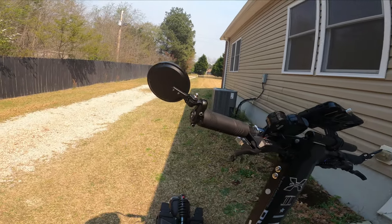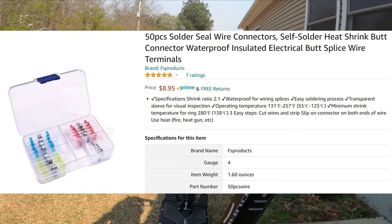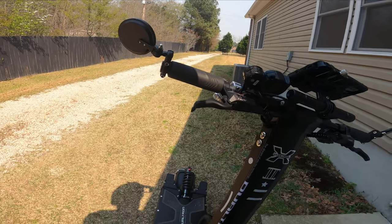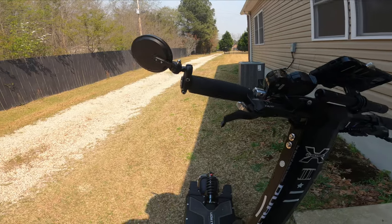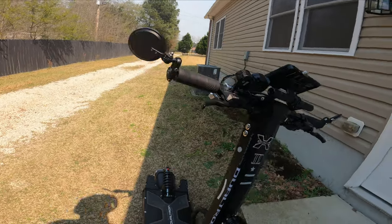And then I just also wanted to experiment with those shrink wrap soldering tubes there with the solder on the inside of them to see how they work. And they work pretty good. I just didn't like the amount of heat I had to put on them to get that solder to melt. And then finally when it started melting, it looks like it wanted to run a little bit. But I got my wire saturated, I got a good connection, so as you can see I was able to ride